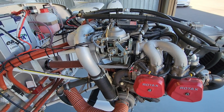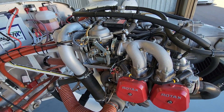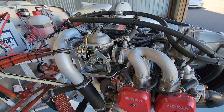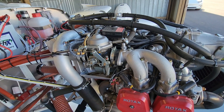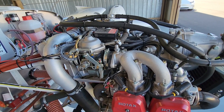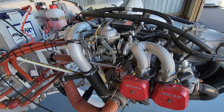I'm probably going to adjust it at 2500 RPM, which is for me probably the best because you get the most out-of-balance issues going on at low RPMs. At higher RPMs the butterfly valves in the carburetors are pretty wide open and you've got this compensating tube that really helps balance things out.